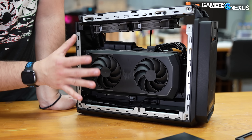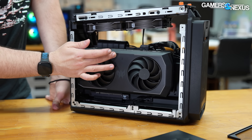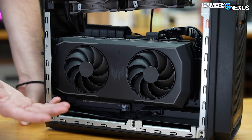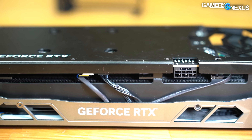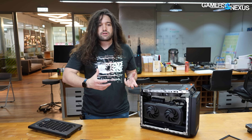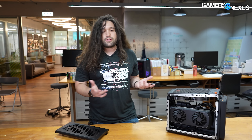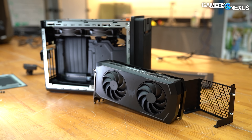Challenges for something like this — pros and cons. Pros: you potentially pack a lot of cooling into a smaller area. This ends up being about 20 millimeters shorter than a Founders Edition card, so it is technically smaller. As for whether it's actually better, we'll have to test it. In the past with some Asus designs we looked at previously, the issue ended up being one of getting the air out of the system, where they pushed all the air in but then trapped it with the shrouding around the body of the card, so it ran pretty warm. Sometimes it works well, sometimes it really doesn't.